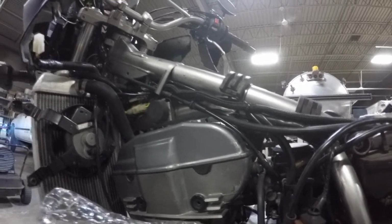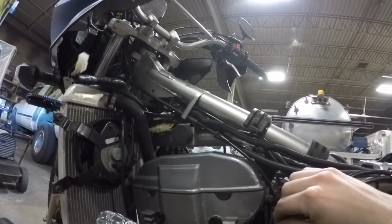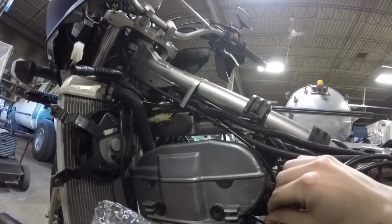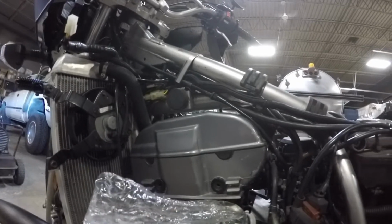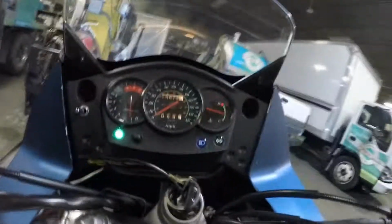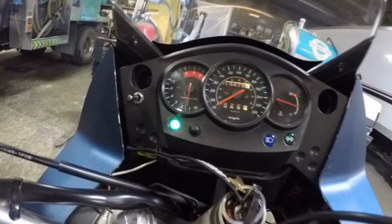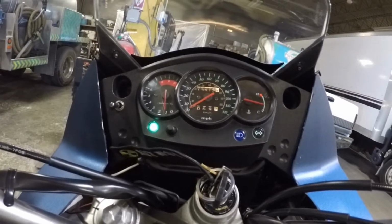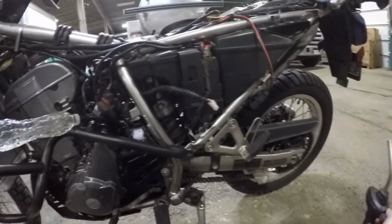Notice how the RPM goes up. I take it away. Now it's normal. I go back and put the propane back to it. You'll see it jump up. That's what you're looking for. And then you turn your tank off when you're done. So that's how to check for a vacuum leak.